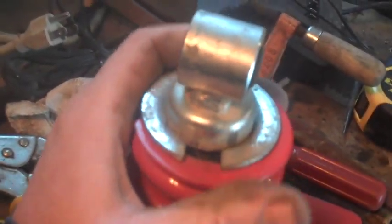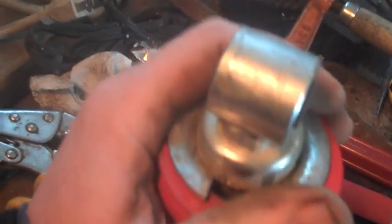Once you've done that, put your new spring on it. I didn't even use vice grips for this part — I didn't need to. Just pry up against the shock the opposite way, slide the keyway over your screwdriver and up and under, and if you're prying hard enough, it'll go right through the shock stem.